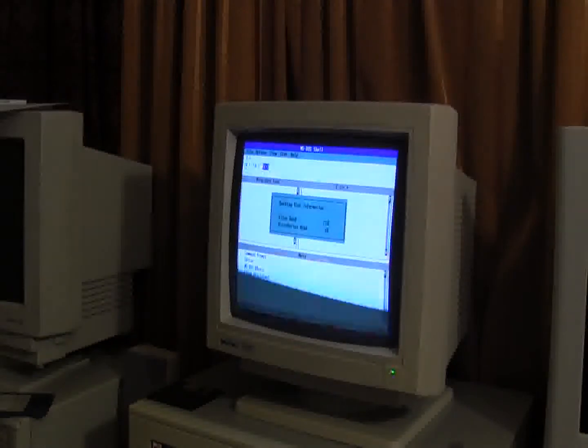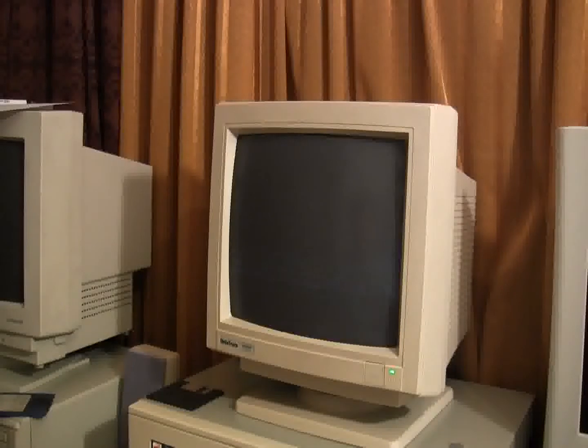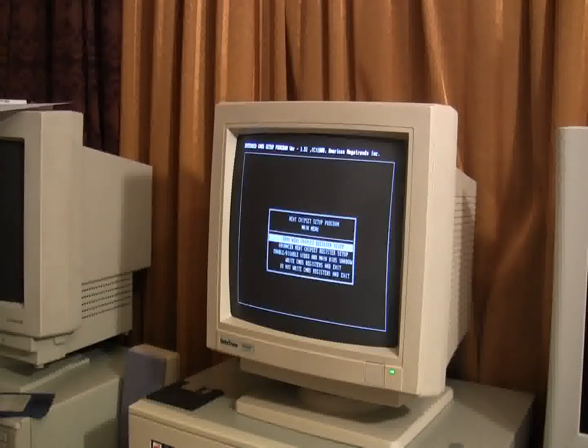So what I'm going to do now is just restart here, restore the full memory requirements, and, well, the full 4 megs back, and install Windows 3.1 on DOS 5. Then take it back down to 640k and see if I can at least run it. I don't know, I guess that's the whole point of this experiment. Will it run? So I've already sort of proven that my memory has some holes in it. Let's just see what this will do.